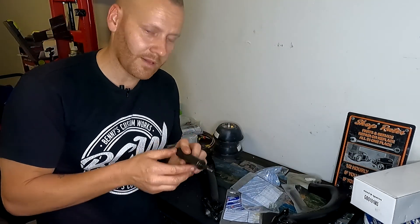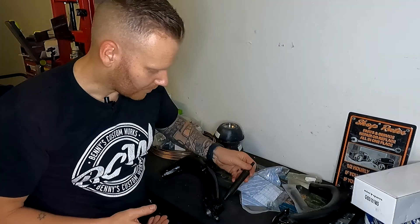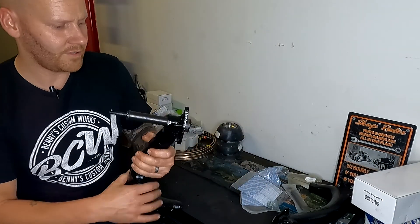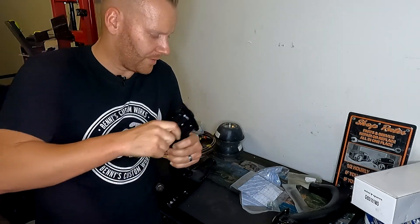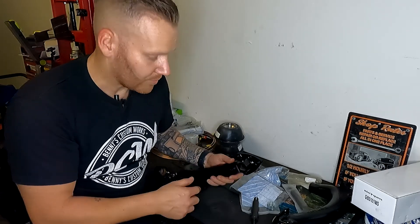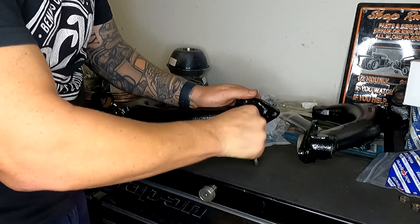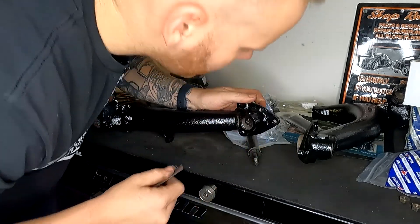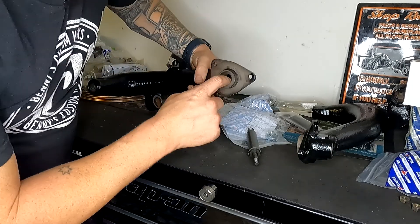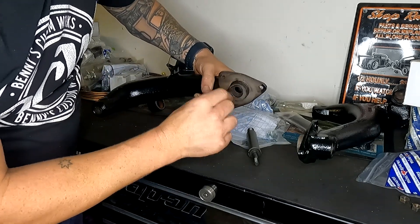The new stub axle actually comes with a circlip at the end, so we don't need to replace it separately. It's going to come in from behind. Because it's been powder coated, there could be a little bit of burr on the inner edge, so I'm going to grab some emery cloth and clean that up so it can mount properly and go in cleanly. Grease is going to travel all the way through the arm to help lubricate everything - that's why it's all open on the inside.